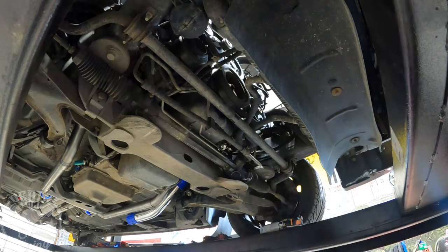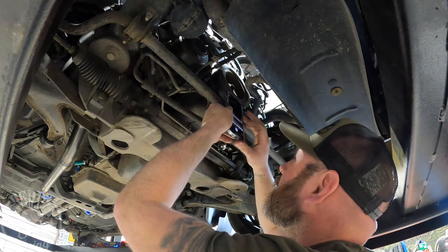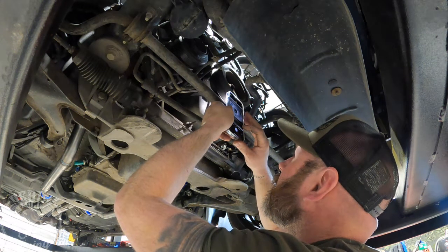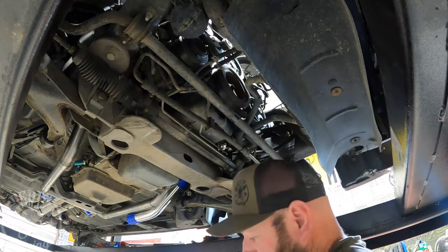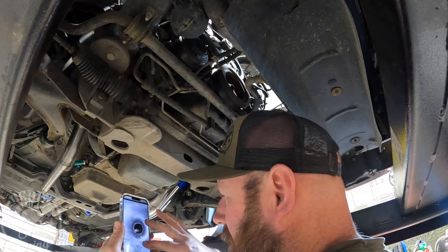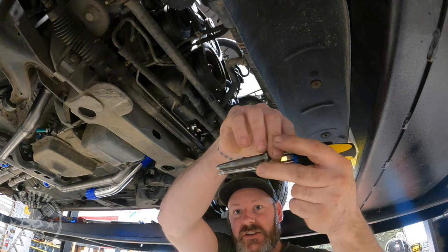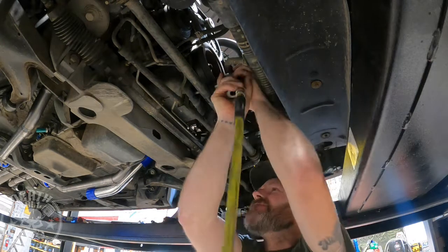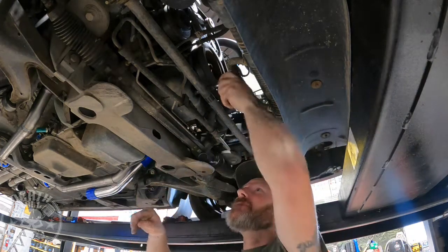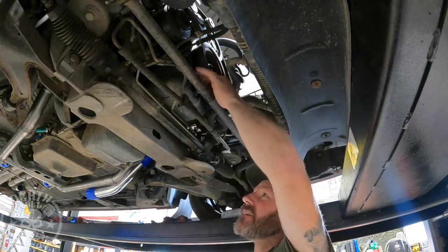Let's take a look in there with the flash. So there is something in there. It looks like we have about three inches or so before we hit — that's the baffle. I was afraid it was the oil pump. The 5.4s have an oil pump pickup that appears to go down the center, and the 4.6s are off on the passenger side. Now I'm tapping it.